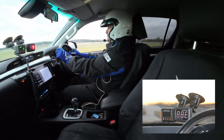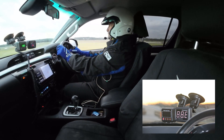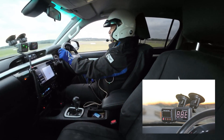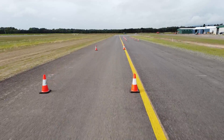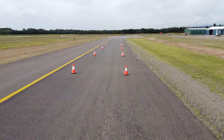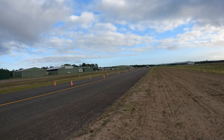In the vehicle, we wear safety PPE including a helmet and gloves. There is a GPS speedometer for accurate speed control. I also use a tilt meter and sometimes have a V-Box data logger for testing as well. For the first stage of testing, the vehicle needs to be at its tare or empty weight, except the fuel tank must be filled to 90% of its capacity. The driver's weight must exceed 68 kg, and all standard equipment such as spare tyre and toolkit must be installed, or additional weights are added. This is known as the vehicle's Test Mass 1.